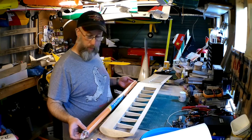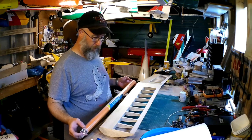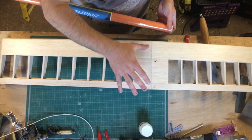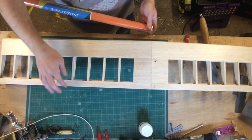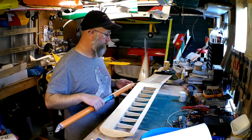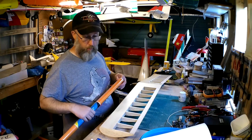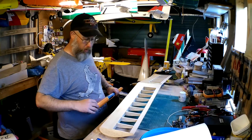The rolls are just the right width to cover one panel at a time. So I'll be cutting out a panel, applying it by sticking the centre first, pulling it tight, tacking it at the ends, doing the tip, tacking it at the middle, putting it all tight, then going over the whole lot to heat-shrink it down so it's nice and tight, and then trimming up around the edges. That's what I'm going to be getting on with — I'll try and describe what I'm doing as I'm doing it.